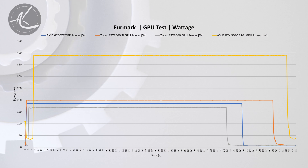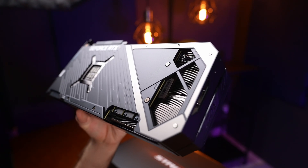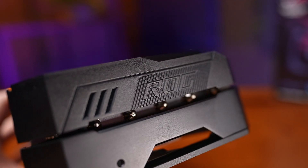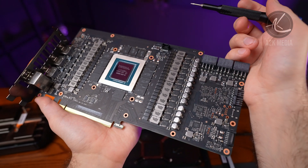For those who are planning to overclock it, I recommend getting a pretty beefy power supply. While running a benchmark, it was pulling just shy of 400 watts, so with a moderate overclock it could pull 450 or more. To quickly wrap this up — it is evidently a high-end card and should be treated as such. While street pricing is insane compared to previous generations, it is about right compared to market prices over the last year or so. No one's thrilled about it, but you can't really do much about it either. If you can afford a card like this, get it — it is a really good GPU. If you want to check it out further, there's a link in the description below.